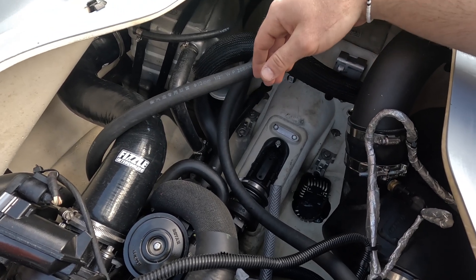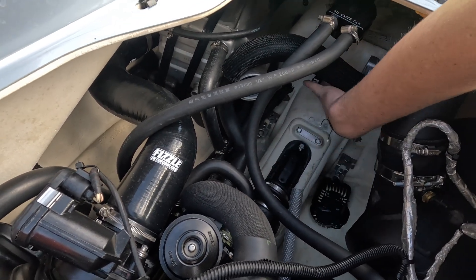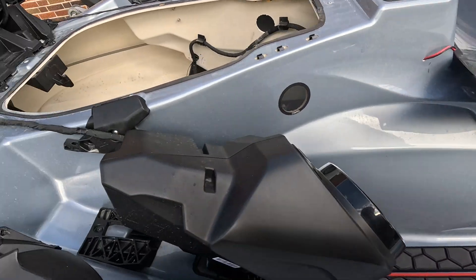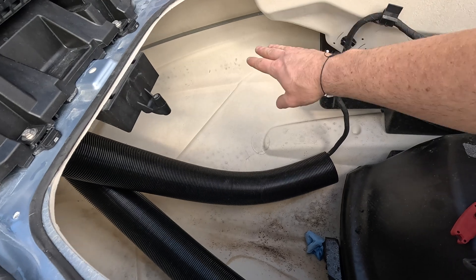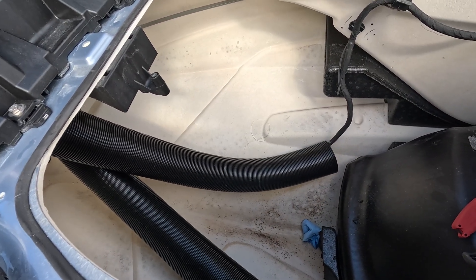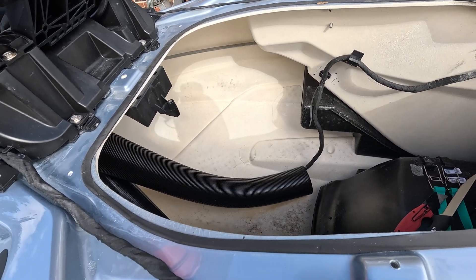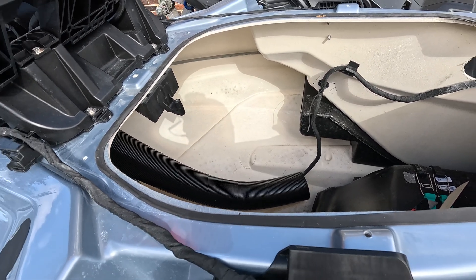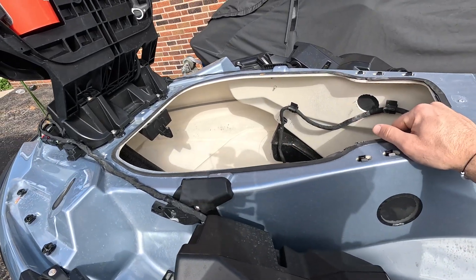Basically what I'm going to be doing here is laying some fiberglass sheets on either side of the tunnel, on top of the tunnel, and around the area. I'm also going to be laying some fiberglass sheets in the bow area — not going all the way up or anything, just kind of in that general area. Sea-Doo does have some instructions on how to do that, and I'll show you the resin I'm going to be using. I also just made a video on how to remove the front storage bin area if you guys are interested.